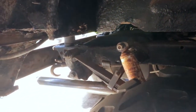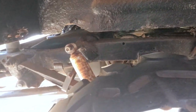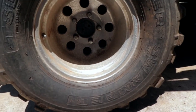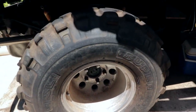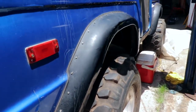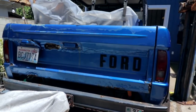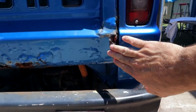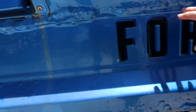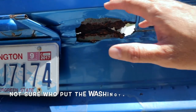Going back to the wheel wells — the frame I had painted with aircraft mechanics paint, so it's well protected with no rust. The exhaust needs to be replaced, the shocks probably need to be replaced, and I'm going to try to restore the rims. It needs new tires. These are expensive fender flares but I can restore the fiberglass. The tailgate did not survive the 10-year battle with the elements — it's rusted through and all the skin needs to be replaced. If I can find a tailgate in better shape I'll swap it, otherwise I'll get rid of this one.